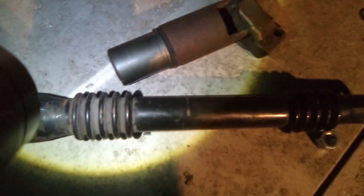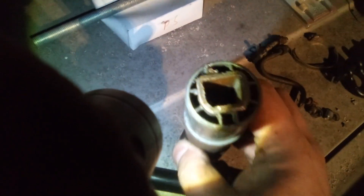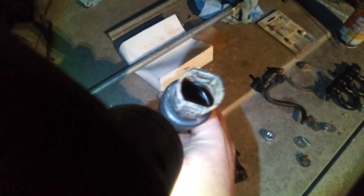Got the steering shafts out. This here is the Chrysler weird funky thing that sticks up through the firewall and makes a seal, ish. I know it's 36 splines — well, they're mostly worn off, but there's 36 splines supposed to be in there. And it's a three-quarter inch. This only fits on one way. It's a D thing. That's plastic — that's what goes into the steering column to go to the wheel. This here is the shibby part. It's double D.